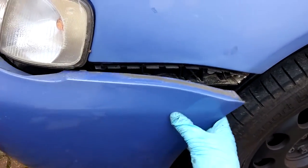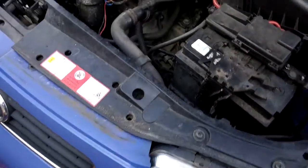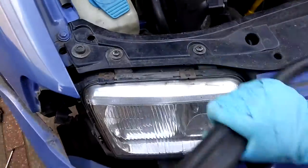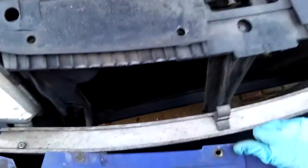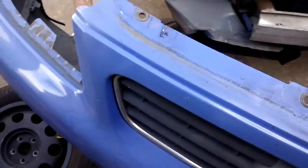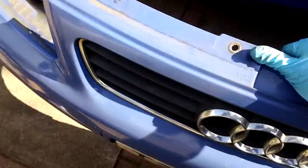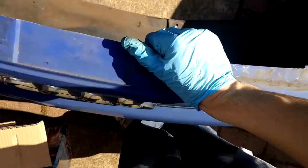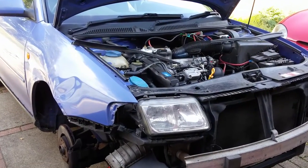We're going to take the bumper off from the passenger side down as well, so that's going to pull off. We're going to take off these rubber skirt trim covers — just pull them off and take them to one side. You can see the bumper is loose now and it will literally pull off. So you've got the four clips on top, the two screws underneath, and it pops onto either side — it may also be screwed into the arches. Now the bumper is off and we can start to deal with taking the wing bolts out.